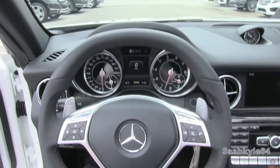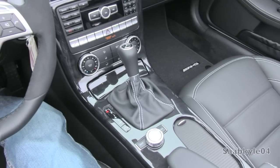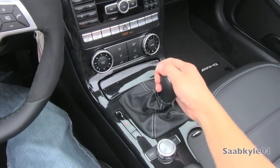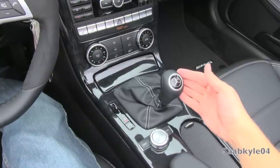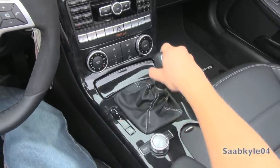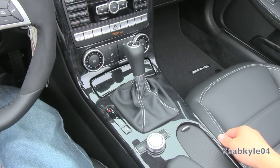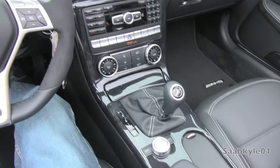The SLK delivers power to the rear wheels via AMG's Speed Shift Plus 7-speed automatic transmission. While similar to the torque converter's 7-speed auto in the standard SLK, the AMG multi-clutch gearbox uses a wet clutch pack to couple the engine and transmission, allowing the car to deliver low-speed smoothness of a typical automatic with the benefit of near dual-clutch quick gear changes.